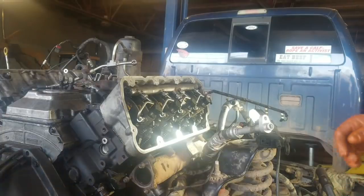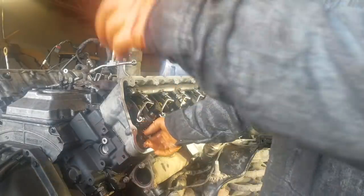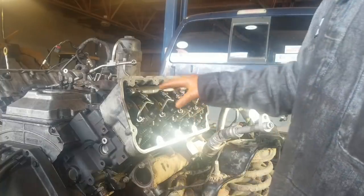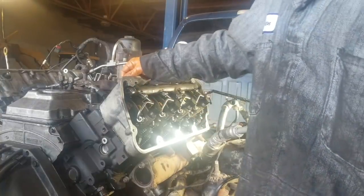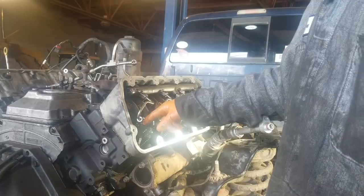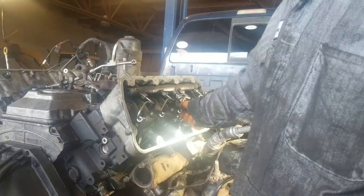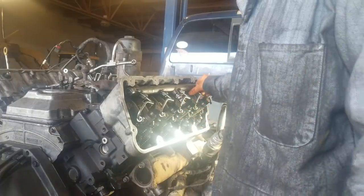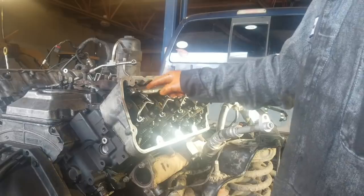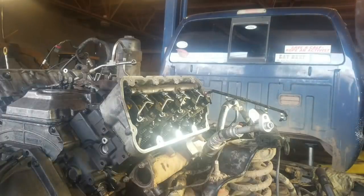Okay guys, so got the injectors in, got the hold downs, cinch them down, back them off a couple turns. Hold downs are loose. Put all those in there. Put your fuel rail on. It's loose too. Bolts are loose. Put your fuel tubes on, going from there to your injectors. Snug them by finger. Once you snug those by finger, it's supposed to be 1.5 foot-pounds, which would be 18 inch-pounds, which ain't much. That's why I just finger tighten them. Next step is, after you do that, final torque the rail on it, which will be 114 inch-pounds.